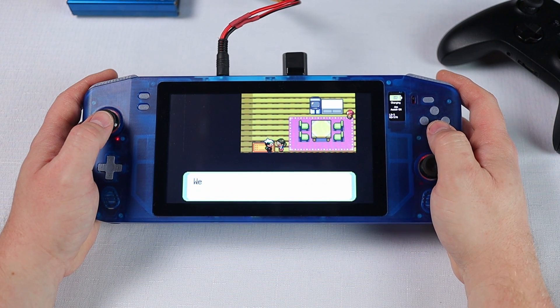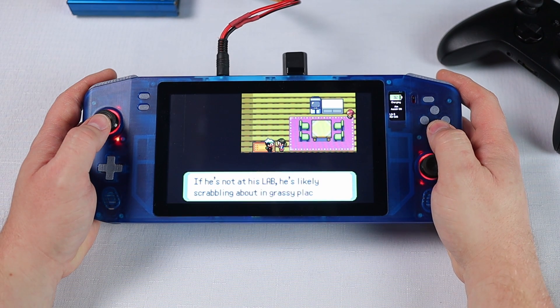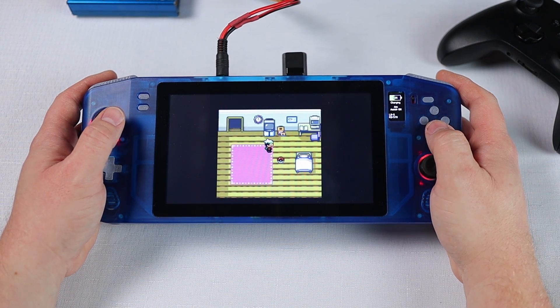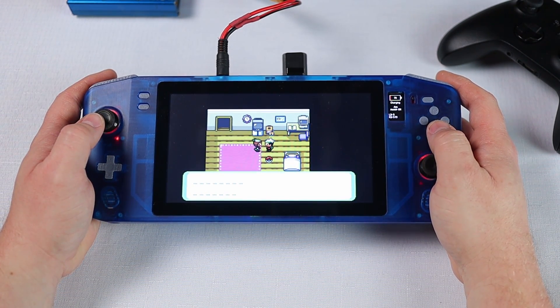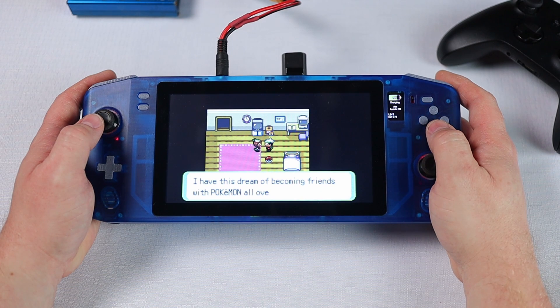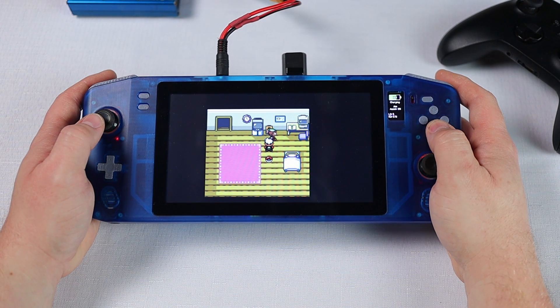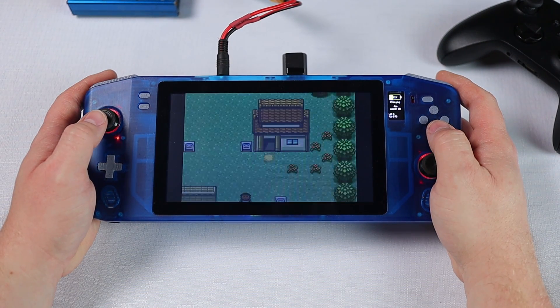Today I'm just going to be testing out a few games with the NUC running through the wattmeter so I can give you a rough estimate of run times for different platforms and games. The measurements I'm taking are entire system power draw, not TDP, so this should give us a pretty accurate measurement of how long we can expect these platforms to run. These are obviously only relevant to the 7th gen i5 NUC I've used in my build but it should at least give you a baseline of what to expect. I have Afterburner running but it doesn't appear to support FPS on this particular version of Intel's integrated graphics, so we'll just have to judge how smoothly the games run by eye. The video is filmed in 60 FPS so it should be pretty obvious if any games aren't running smoothly. The display is also limited to 60 FPS so I have V-Sync turned on so we aren't wasting power producing frames that we can't display.